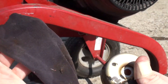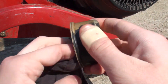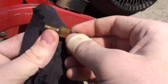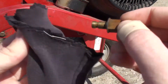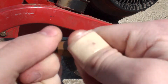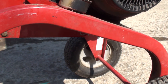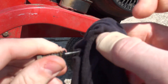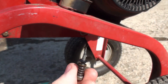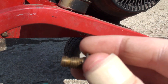We're going to wipe off the outside — you can see it was kind of covered in bits of twigs and stuff. Then we're going to clean out the inside; it's really dirty. Use some carburetor cleaner or some gasoline to make sure you get all the dirt out. You can see it's nice and squeaky clean in there now. Now we're going to clean off this main jet — just going to wipe it off to start with. The jet holes on here do not look blocked, but I'm going to clean them anyway. We're going to remove the adjustment screw and clean that. That's actually a bit dirty in there, so I'll just wipe that off. Make sure there's nothing in the threads or on the seals of the adjustment screw — don't want to damage these seals, they're kind of fragile. Make sure there's nothing inside the jet; you can see light through it and through all of the little pinholes on the sides.